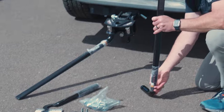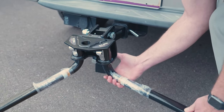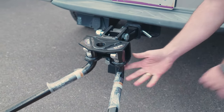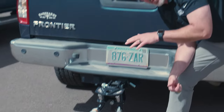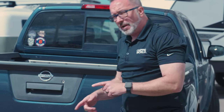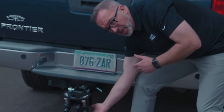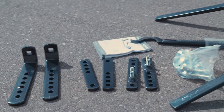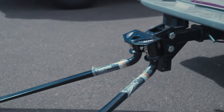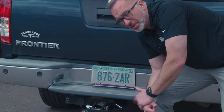Setting this one up is fairly easy — just watch yourself a little bit, find a good insert point, and it locks into place. The only thing with round bar systems I've found, because of the weights they come in — six, eight, or 10,000 pounds — if your travel trailer is heavier than 10,000 pounds, or you need a little more rigid sway control, you probably don't want to go with round bar. Also, if you have a low tow vehicle, the ground clearance, because of where the bars enter the hitch head, could pose some potential issues. But for flexibility, easy hookup, no chains, and nothing to take off when backing up, this is another great option for weight distribution with sway control.